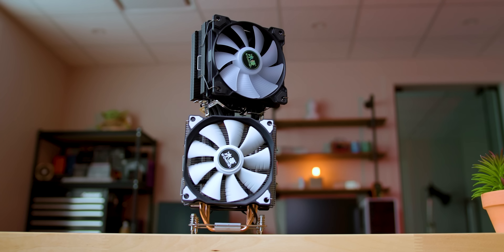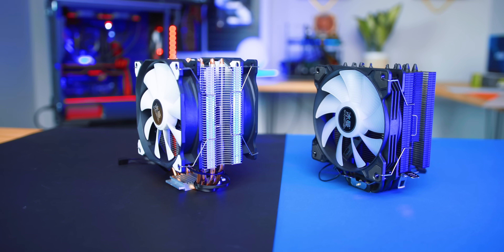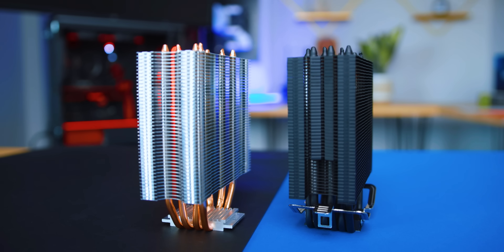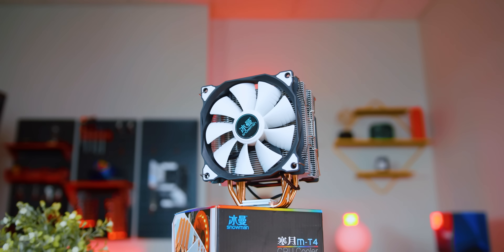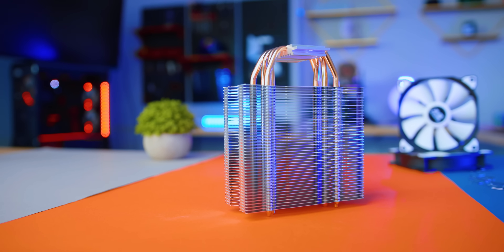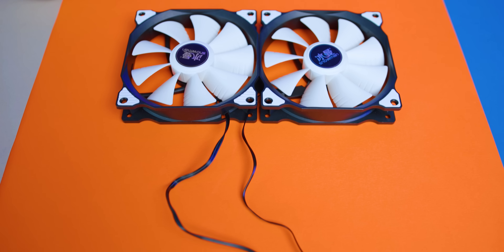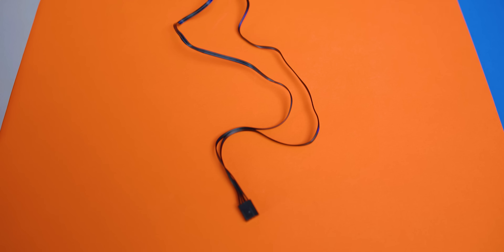So what do you get for these inexpensive prices? These might look like the exact same cooler — the MT4 having four heat pipes and the MT6 having six — but they're actually completely different designs. One of the main differences is the fact that the MT6, even though it's a higher-end cooler, actually has a smaller height. Other than that, their thickness is completely the same. The only difference with the ones I have here is that I have the dual fan version of the MT4. The MT4 is a basic heat sink with four direct touch heat pipes going up into a standard silver fin array. One issue I have is that both fans are linked together with a single cord — there's no Y-splitter, and I would very much prefer a Y-splitter.